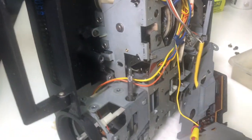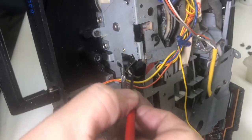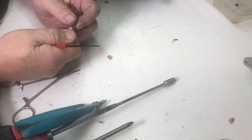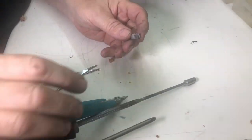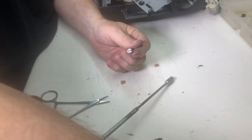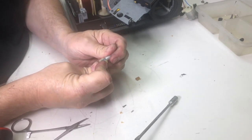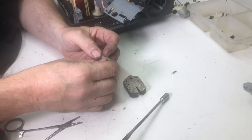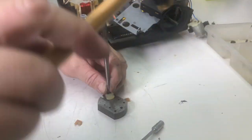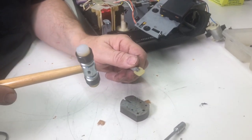Turning the projector on its side, go ahead and get it to come out. You can see how brittle these parts are — they're just breaking off in my hand. Let's cut the rivet out of it. We're going to take the new link, put it in place. Then we're going to use the rivet — not a cotter pin, the rivet. Get our punch. And voila, it's together.